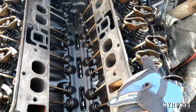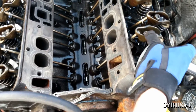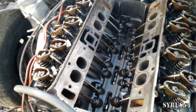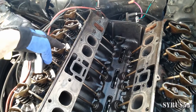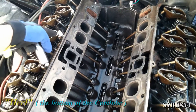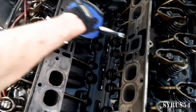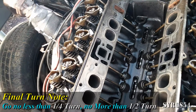When you've got your number one intake at full valve lift, you don't want to adjust the number one — you want to adjust the number six. With the number one cylinder intake at full valve lift, come over to the number six cylinder intake because it's going to be on the heel — completely closed. That is when you want to tighten it down. Take out all of that play back and forth and up and down movement of your push rod, then go one half turn following the block.